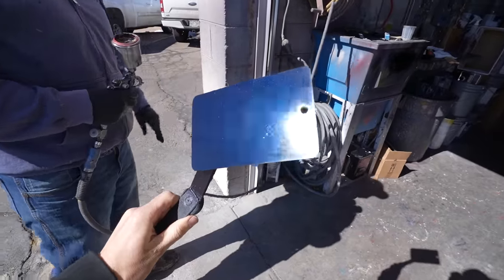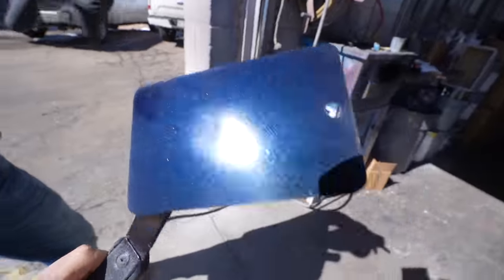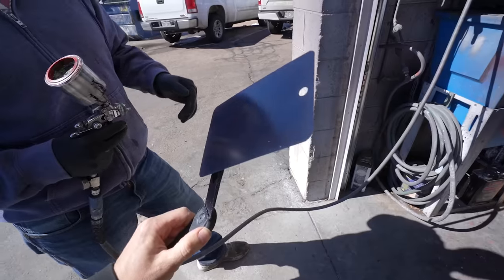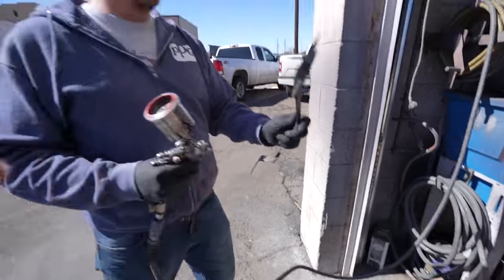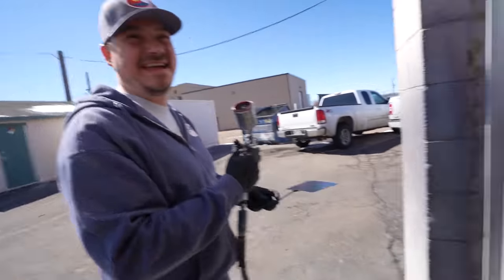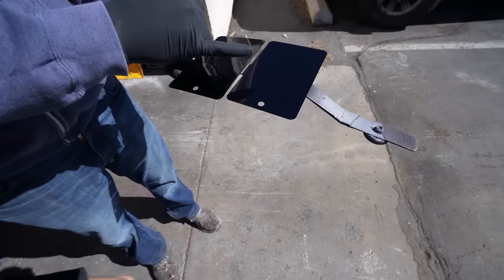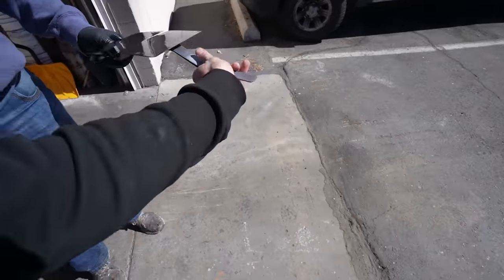I don't know, it almost doesn't look any better than the other, and it costs a lot more. The OEM colors tend to, anything with violet in the formula, your side tone, your flop goes muddy. I think you'll be able to see it when we compare it to the color with the pearl over the black. That'll look so much blacker. So I need to go get the quick check. What do you think? Pink. There's the pink. Fire. See it? Oh, yeah. I do see that pink.